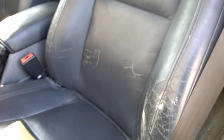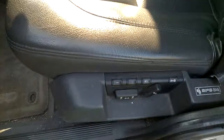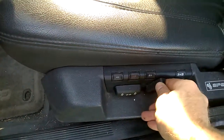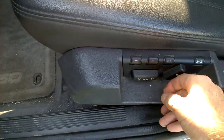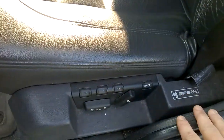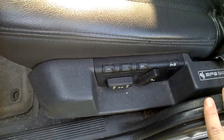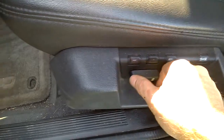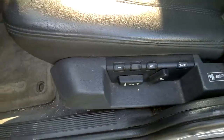Interior: the driver's seat has typical wear but still functions well. I do have replacement seats for it. What doesn't work is the tilt mechanism — it's been broken since I've had it. From what I read it's just the cable that popped loose inside the seat, and you have to take it all apart to reach it. The front-back adjustment and memory seat selections do work.